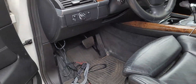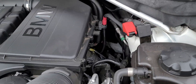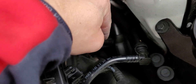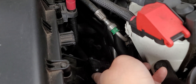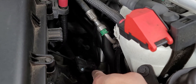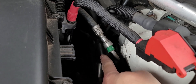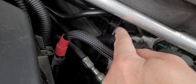For the boost tap up front — I didn't find anything online for this either — it will go right here. You'll have to buy this adapter piece, this black piece. The adapter will go right there, the vacuum lines plug in right there. I routed it through the side here; I drilled a little tiny hole right there for it to go through.